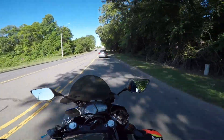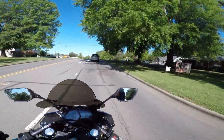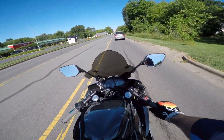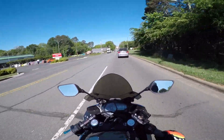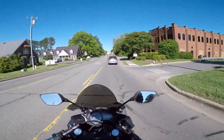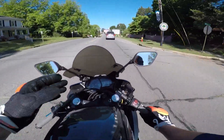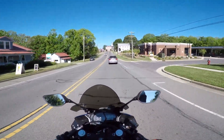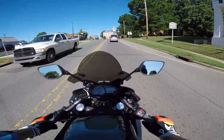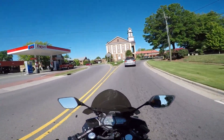The Norton Motorsports flash I like probably the most because of the throttle cut. When you roll off the throttle, the jerkiness — the lurch forward — absolutely drives me crazy on my FZ07, which doesn't have a flash or anything. This bike is infinitely more smooth, and that's why I might end up flashing my 07. I highly recommend the flash for this bike if the throttle cut is annoying to you too. You've also got miles per gallon on the dash. I'm not sure if it's still accurate with the flash, but I think you get such good MPG on this bike that it really doesn't matter.